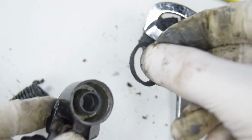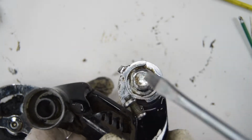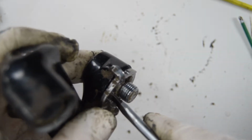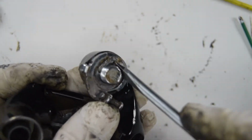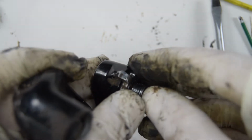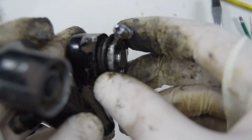Let's take off that spring, and there's a seal here. Let's work on the next bolt and spring to remove. So at the back there will be a clip. You need to position it so that when we take it off, you can get into that opening part. Okay, that's done. So now I'm going to pull it out. You can put your finger down here to avoid it smacking open onto one of your own fingers. If it doesn't let go already, mine is because that stopper there was kind of already broken, so nothing was really holding it, but usually you'll need to pull them out.